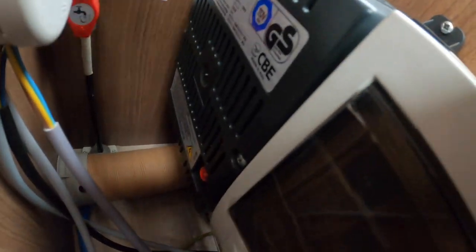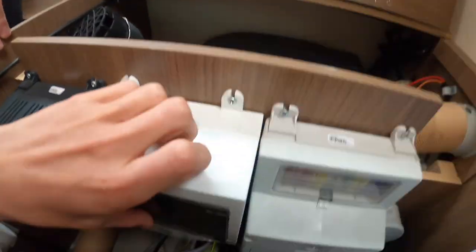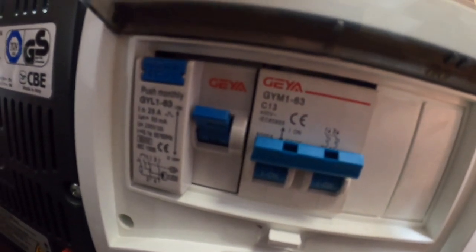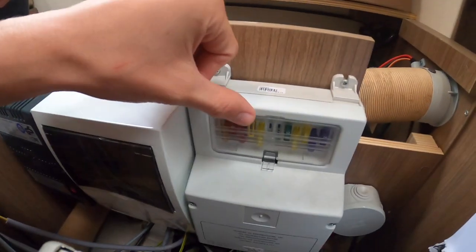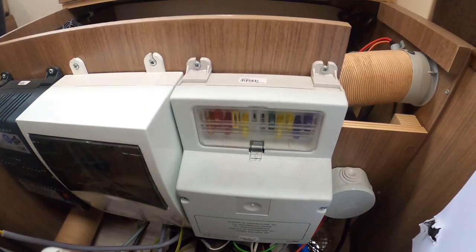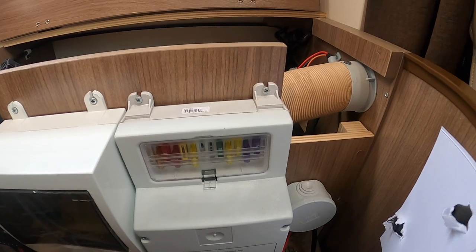Also when we're here, you've got your charger which is on here. You've got your trips in there — so trips are in here. If your kettle or hair dryer trips the vehicle, try here before you try your site supply. And you've also got 12 volt blade fuses here which work your 12 volt appliances. It would be a good idea to go and buy some spares just in case one of the fuses blows — you can take them out, see if it's blown, and put a new one in.